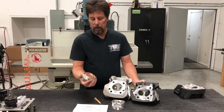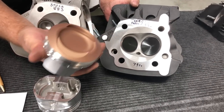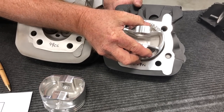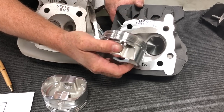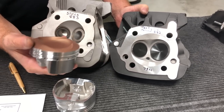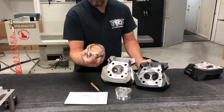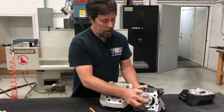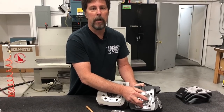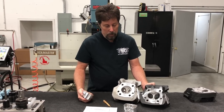That's where this piston comes into play. This is a 30-degree piston, and we've machined both sides of the chambers at 30 degrees to match the 30-degree dome on this piston. This piston closely matches the angled squish-band cuts, creating an angled squish band with actually more surface area than you'd get running the standard conversion piston with this chamber. This is an improvement in squish-band surface area, chamber turbulence, and because this dome has more volume, you get your compression ratio back up to where you need it to run the bigger cams.